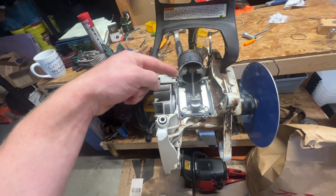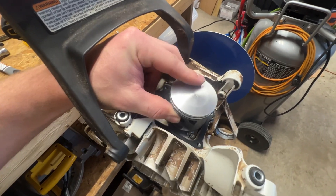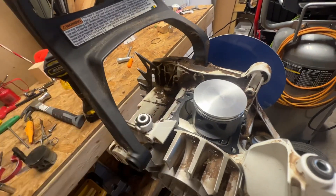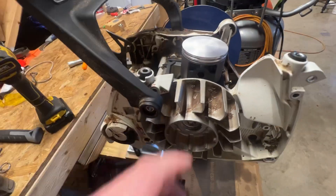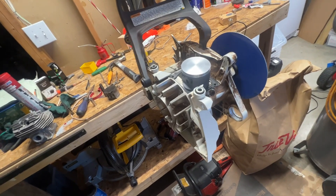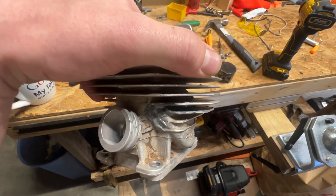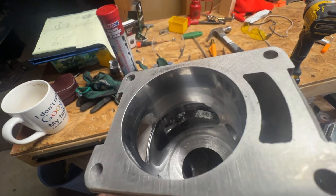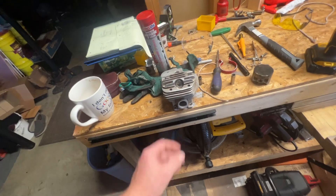I took 430 thousandths off the skirt and did a 40 thousandths tapered pop-up at a five degree angle. I polished it so less carbon will stick to it — you can still roughly see that pop-up outline. The real reason you want that pop-up is because of these primary transfers. I ground through when I was beveling the back wall of the primary transfers, and I have them opening a couple of degrees before the secondaries because they are compromised.